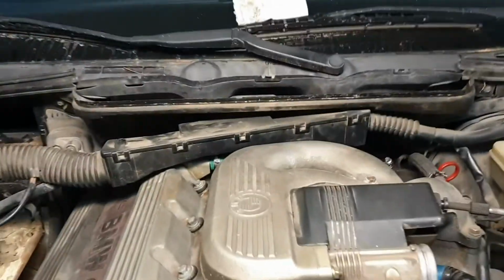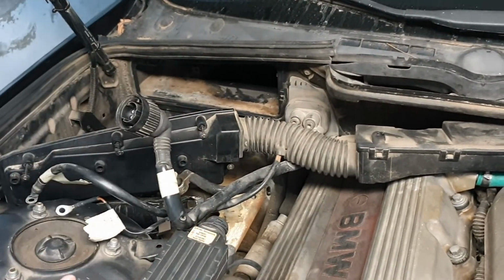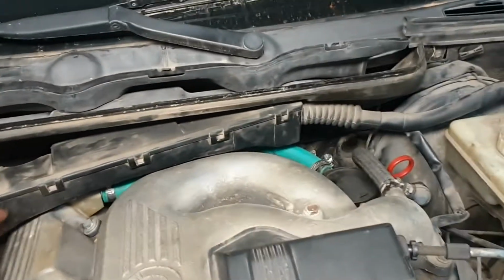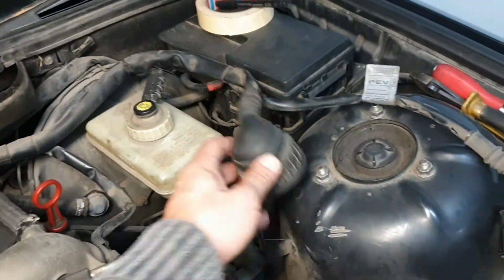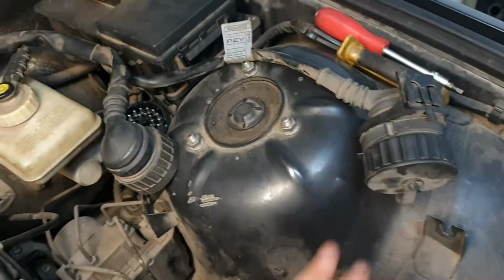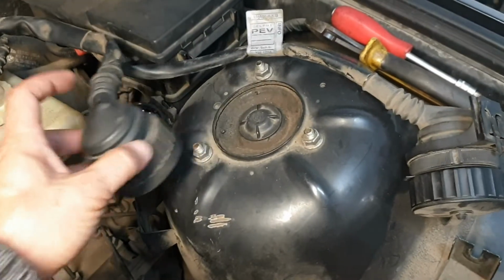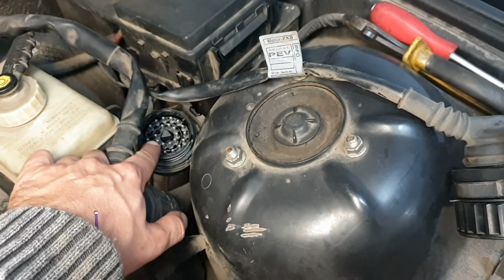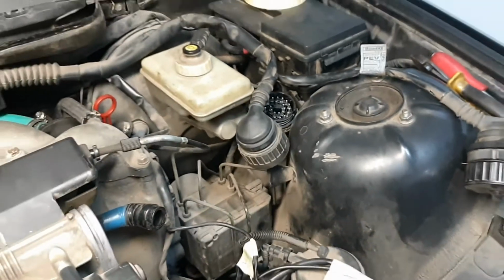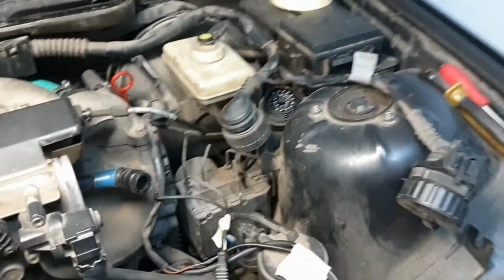There are not so many connections here. You have all the cables that go to the computer and to the coils here, and they go all the way behind the engine, and then they end up in the connectors. So this connector is to connect the computer in the BMW. This is going to be kept away. This connector is going to be changed so it is compatible with the connection on the E30. So this will be for a next episode where I will show you how to make a connector. The whole point here will be to use the connector on the E30 that I have upstairs.